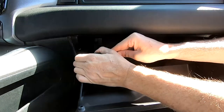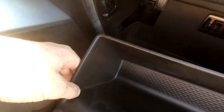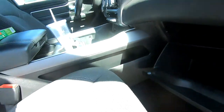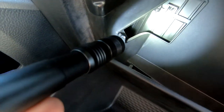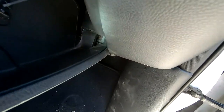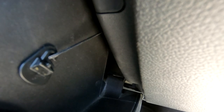I didn't pull forward — we want this latch to move towards the right. With some muscle, it freed up. When the left side unlatched, two of the hinges snapped out, which was good, but I still had the right side hinge attached. Here's a better look at the left tab. This connection with the string? No need to take it off — all that will do is make this job harder when putting the glove compartment door back on. With some gentle pulling, the right side snapped out.